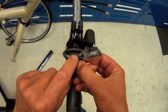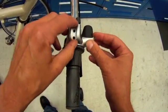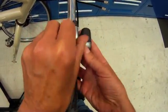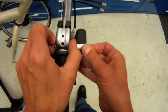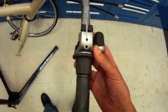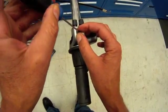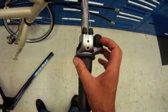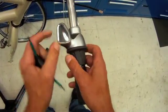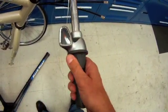The plastic cover comes with a small spring foot that helps maintain the cables fully in their groove — no need to take that out. Let's make sure this is fully settled in the shift lever, just like so. Very gentle torque is needed on the screw — just gently snug is enough. That's ready to go, and of course we have to return it to a usable position for our customer. There's again the cyclist going up and down the little hill, and we'll gently set the set screw so it can't rotate when they're riding.